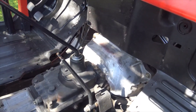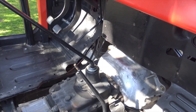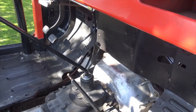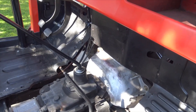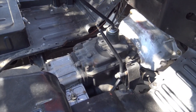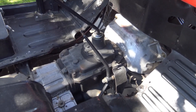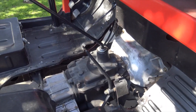Let me show you from another side what it looks like. The regular 4-speed with the 4-speed transfer case: the 4-speed is a 3.5-to-1 and the transfer case is a 1.96-to-1. The 3-speed first gear is 2.7 and the transfer case is 2.3-to-1. So the 4-speed with the regular 4-speed transfer case, your output at the rear of the case is 6.9-to-1 and at the wheels that's 28.3-to-1. Now your 4-speed with the 3-speed transfer case: your low range output goes up to 8-to-1 and at your wheels it's 33-to-1.